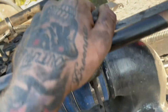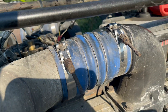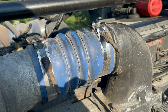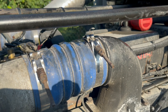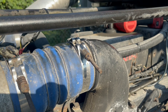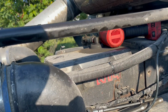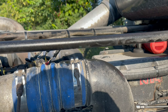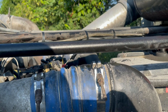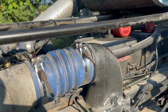All right, so obviously once we started it up, we had one injector down that we knew was down, and now it's running good — we fixed the down injector problem. We're going to go ahead and keep moving back and do all six injectors. He went ahead and bought six injectors, so we're going to install all of them so he'll have a good six-pack in here ready to go. That basically concludes it — it's the same process on every head. Just make sure, again, you check those push rods and everything will be good. We're going to get this thing together and get him on the road.